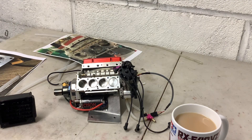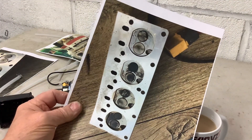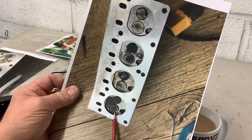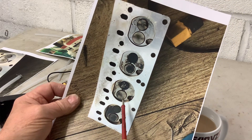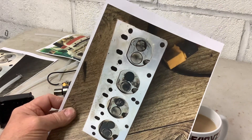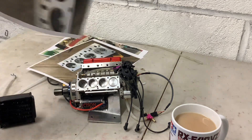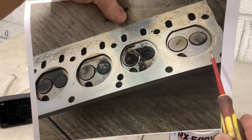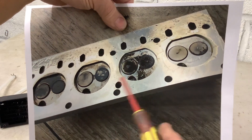So this was the state of the heads. You can see I believe this was number two, which is the worst one — you can see it's black there. And as you go along, you can see they've all been burning oil; all this side has been burning oil. Now a lot of you guys would probably say it's a head gasket, but I couldn't see anything wrong with the head gaskets. You can see the oil is round here, all here, and round all these.